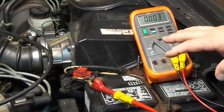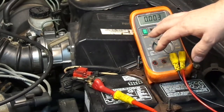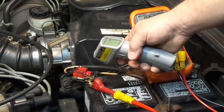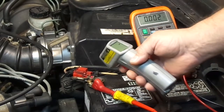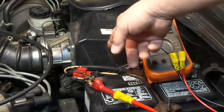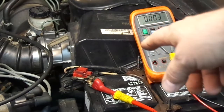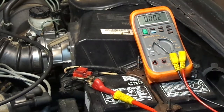So now let's find out what happens when you start the engine. I've already tested this and I know there's a problem. This terminal is 75 degrees and everything under the hood is 75–76 degrees right now, but this thing got so hot I couldn't touch it. Eventually it's going to melt that plug because there's a bad connection. If you just use a volt meter, you won't find it. Let me start the engine — it's a little hard to start because of this connection, so I'll start it, rev it up, get it idling, and then we'll slowly start testing.